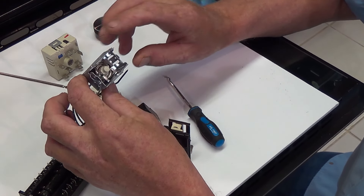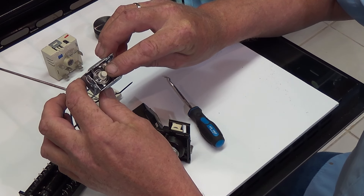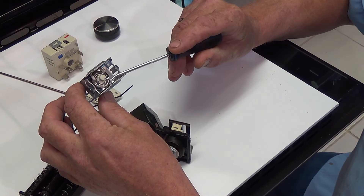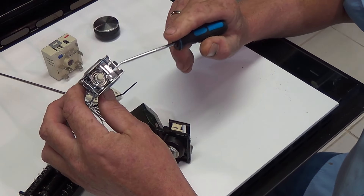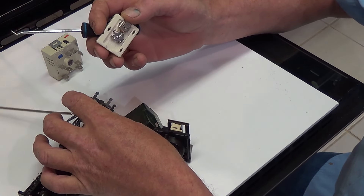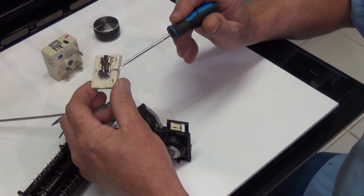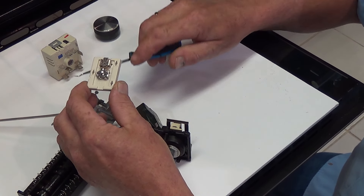The gas expands a little arm inside the thermostat, which you can see here. As you set it to a higher temperature setting, it makes the distance slightly larger. As it reaches temperature, it opens and shuts a set of points, and this is what allows the electricity to go through to the element, controlling the temperature on and off as temperature is reached.